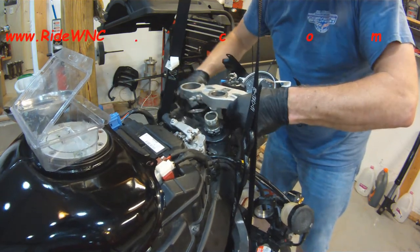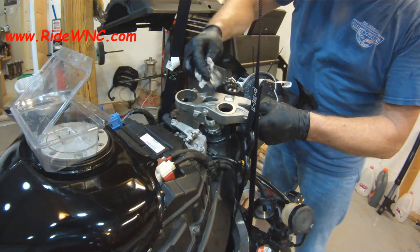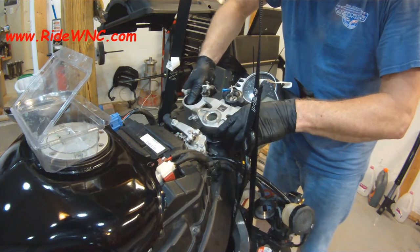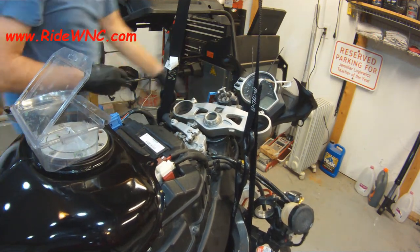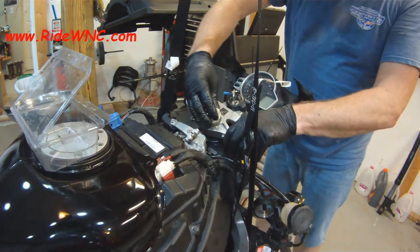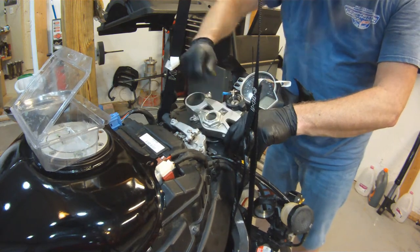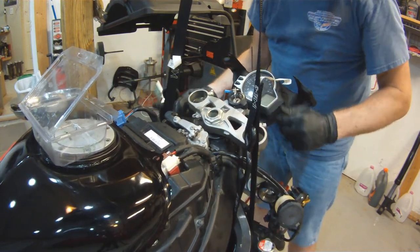This is as far as I took the video — if you're already watching a half hour, it's just too much. I did not do a video showing you how to put the forks in; it's late at night right now and I just wanted to put the bike back together and get it all lined up. We're going to put the nut on to hold it in place — we're not going to tighten this nut down yet. We'll put the forks in and align everything, and then the last thing we'll do is put a wrench on that nut and tighten it back into place. That's how we replace the steering stem bearings. Thanks for watching — I hope you got some information out of it. It's always a pleasure doing these videos for y'all.